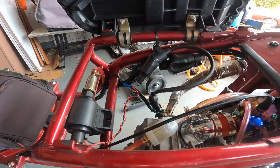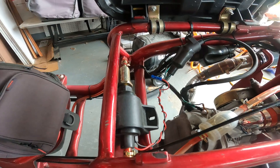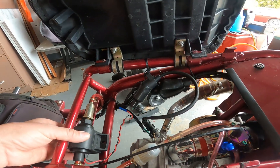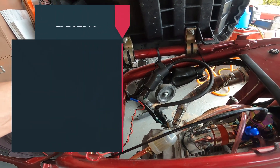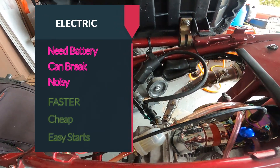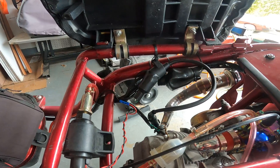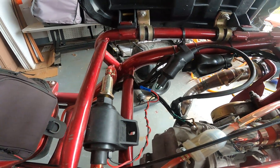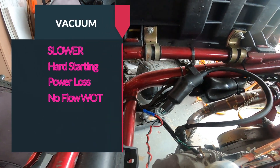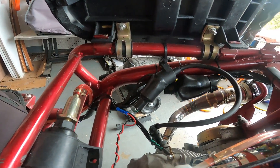The Ghetto Wrench fuel pump was a great idea. If you remember my comparison video, the electric fuel pump was actually the slowest, vacuum being second fastest, and gravity being the fastest. The things I don't like about the electric fuel pump are it's noisy and it could fail — and if it fails, you're screwed. Also, if your battery dies, you're done. I had a battery die on one of the bikes with an electric fuel pump the other night; it wasn't riding. So it would really be nice if we could use that vacuum fuel pump. But the vacuum fuel pump doesn't work at high RPMs and full throttle situations where you don't make any vacuum — the most place you need fuel is where you can't get it. It only works good at idle.